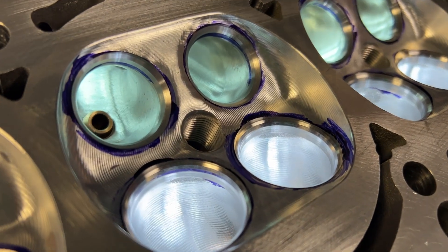We're ready to rock and roll. Things are really moving the way they should be going. We started with the GTE and still have some revisions to make, but we had some heads to get done, and now we're going to move on to the GE. To give you an idea of timing: by hand you're probably talking about nine to twelve hours to fully port a head — at least for me, including polishing. With a CNC it can do it within three hours.